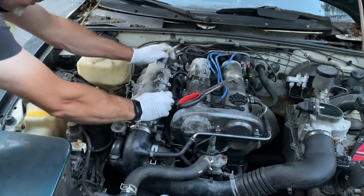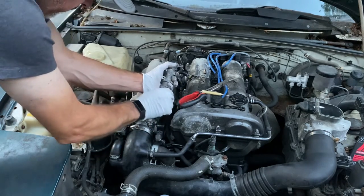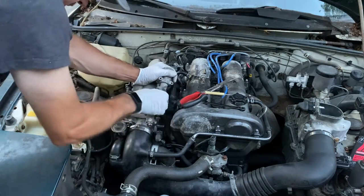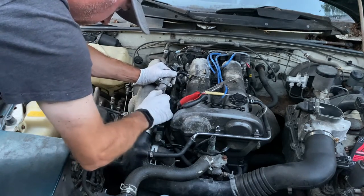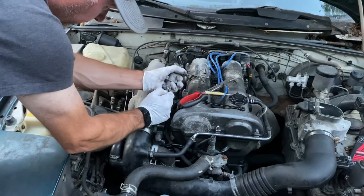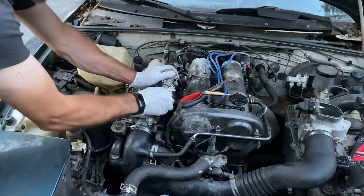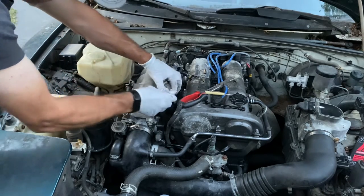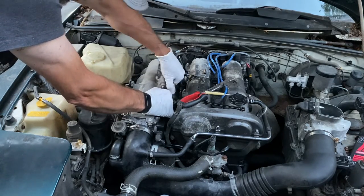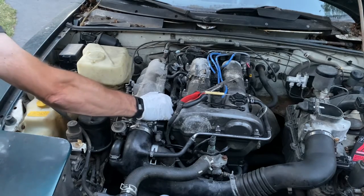Now it's turning, so we'll get that one off right away. Just wiggle it back and forth nice and slow until you get it going. Be prepared for some coolant to come out — try and stand it up if you can. Now we've got coolant coming out, so I'm going to plug it with my hand. It's a little easier now to get the second one off because we can grab the whole thing and twist it without a second line in the way. Okay, that's off.